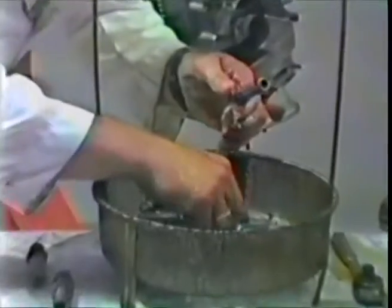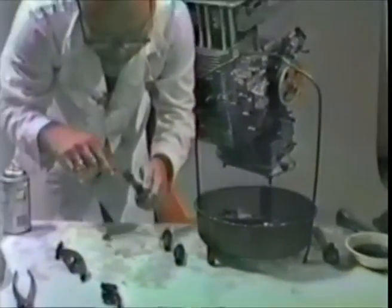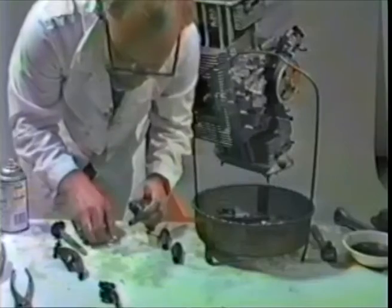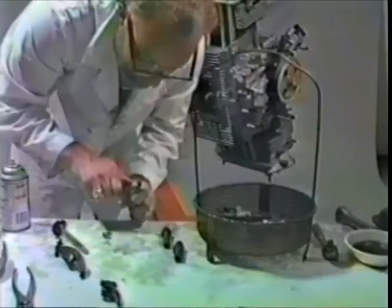It goes, again, shim, washer, spring, shim, spring, shim, secret sauce, exhaust rocker. And again, we may have to use our technique, like so. And again, once it goes in, it usually stays in. Occasionally the other end will come off. Now it's really slippery. So just put the cap back on.